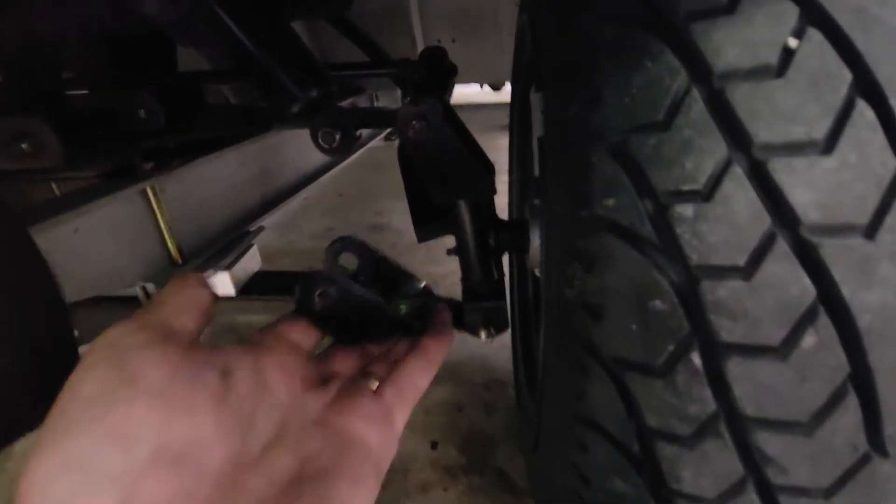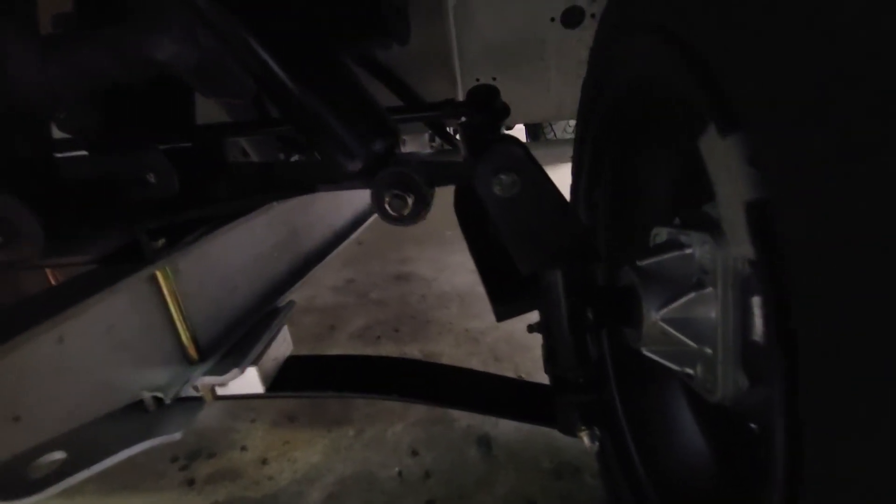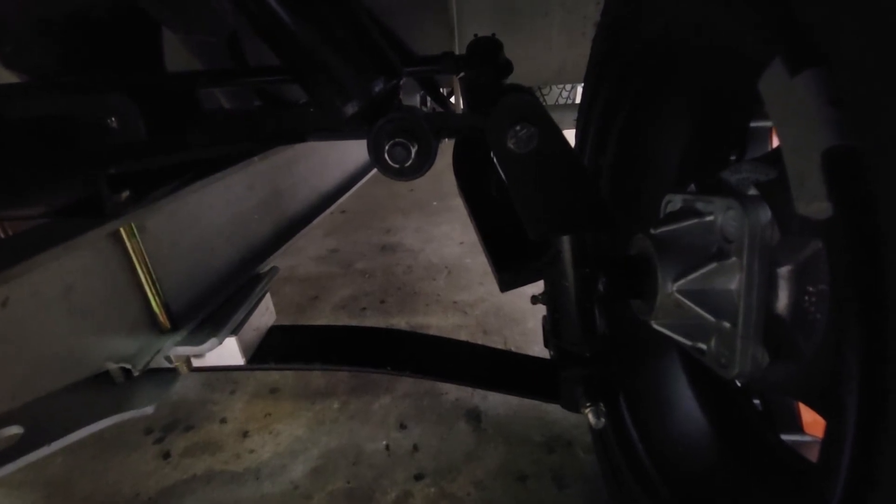Here's a side-view profile comparison. You can see the difference between the old and new clevis — the holes are just one inch straight up to match the one-inch spreader bar. This is going to take care of the camber problem when installing double-take bodies from Custom Golf Car Supply. If you have a Club Car DS with a lift kit or anything throwing your camber off, you're welcome to try and use it.